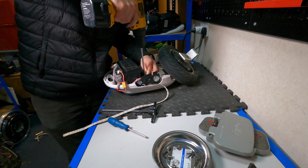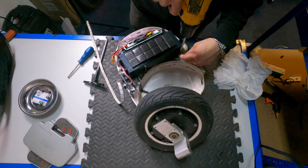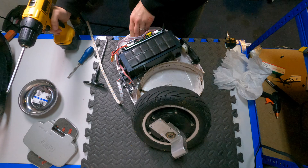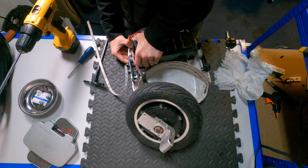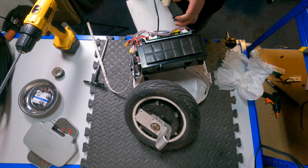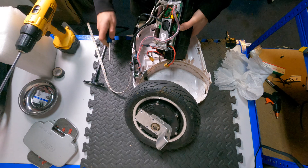That's why we need to remove the screws holding the battery pack to the side panel. Some screws are holding the battery pack to the chassis, but some screws are actually holding the two sides of the battery pack. So just make sure that you undo only the screws linking the battery pack to the chassis. The sticky pads get in the way again, and I found that one of the cables wasn't long enough, so that's why I also removed the rear panel.